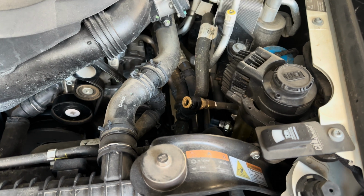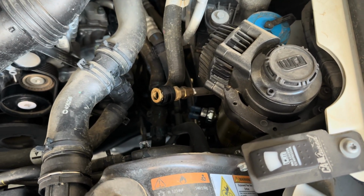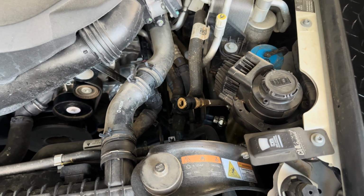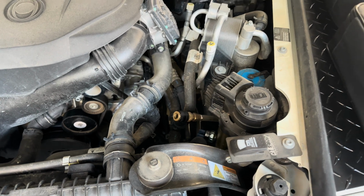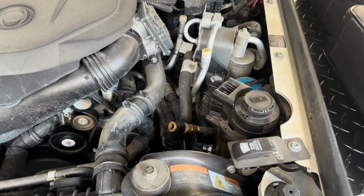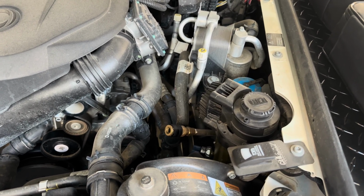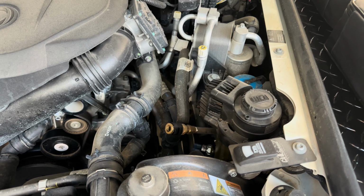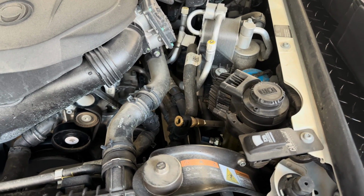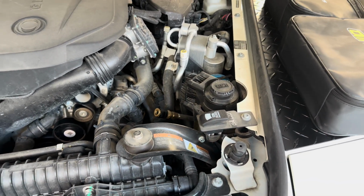Super important for off-roading, as many of you know, because when you're on the trails, you want to be able to lower the PSI on your tires. This helps with sidewall deflection, and it also increases the contact patch, and it makes the ride infinitely more comfortable. It soaks up the rocks and bumps a lot better. So your kidneys will thank you, and your back and your butt.